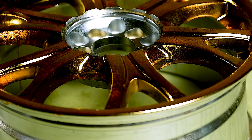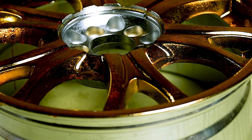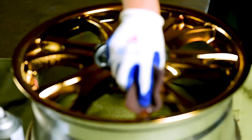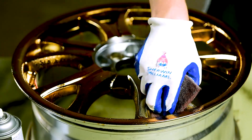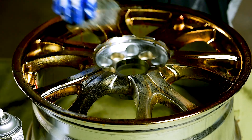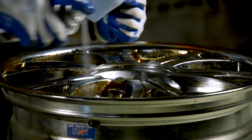Watch for the following signs: softening, approximately 10 minutes for shellac varnish and acrylic lacquer, or blistering, approximately 10 minutes for an enamel. When the action is complete, use a scuff pad to remove the coating. You can also use steel wool for stronger surfaces and/or a scraper. Reapply as needed.